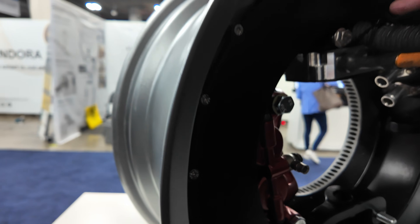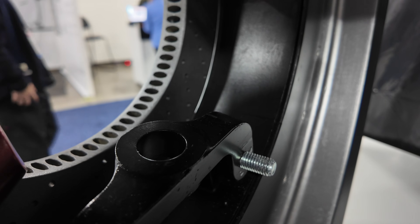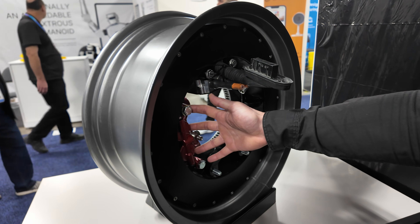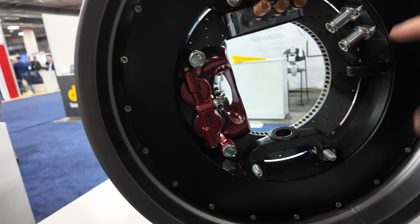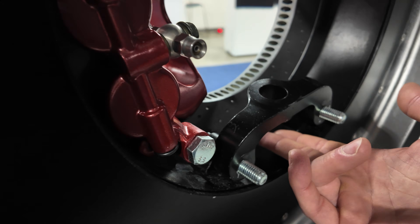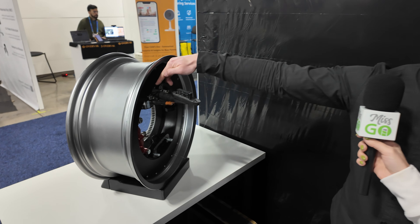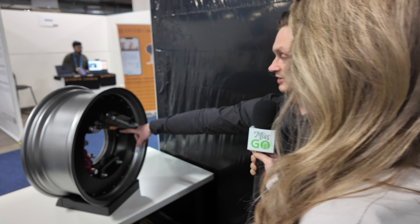Because this is axial flux technology, the magnets are on the side — not on the perimeter of the motor. We have direct attachment of the brake caliper directly on the stator, so as you can see, there is no upright. We eliminated all those components — it's very simple. This is a mount for the lower wishbone suspension, there's a ball joint, and this also acts as a steering axis. The lower wishbone comes in here, this is our steering axis, and the upper wishbone comes on top.